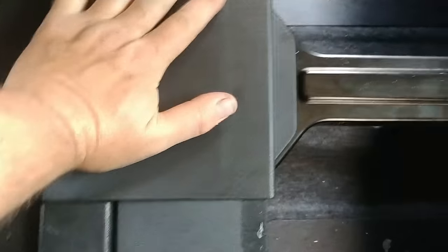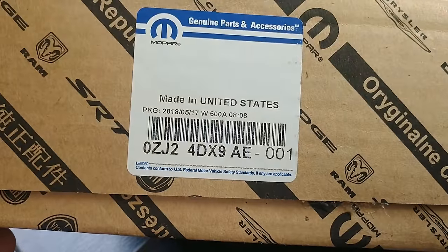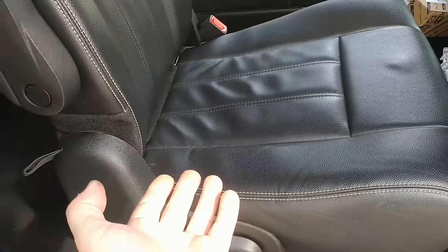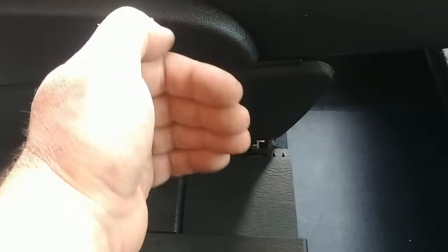Here's the other piece. This comes as one unit — there are four pieces to it. They had a hard time finding this, so if you guys need this for your van, there's a part number for it. What it's supposed to do is when the seats are in the upright position, it covers up this void — there's an empty spot right here. Because when they fold, the backrest slides down, the rear latch lets loose, it hinges up and slides in. These slide into here on either side so that it has the ability to slide in and fold into the floor.